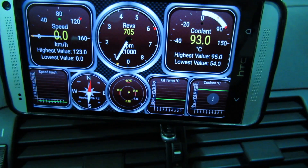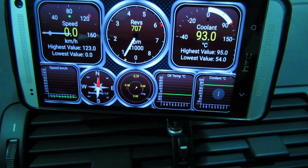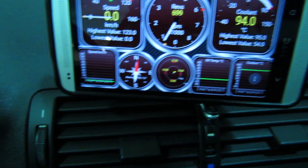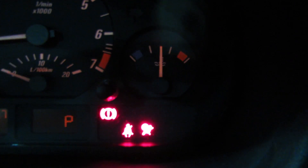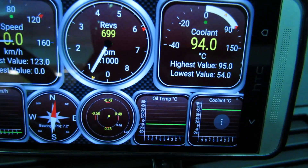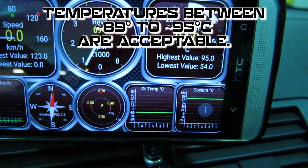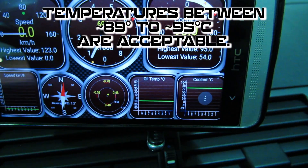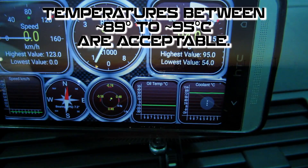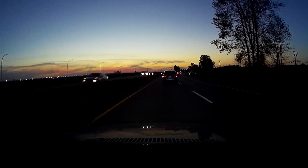After all that driving we've seen the range it goes up and down. Now we're going to let it idle for about five minutes and see where it rests. It was at 94, went down to 93, and has gone back up to 94 and 95 degrees — 94 to 95 must be the optimal coolant temperature. So if your thermostat is working properly it should range between 93 and 95 degrees whether you're driving or idling. If it's going much below or above that, definitely get it checked out.